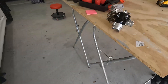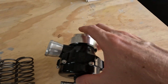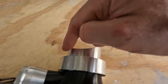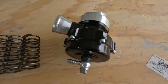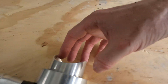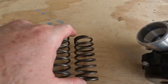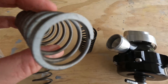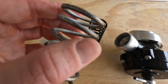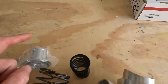I've got one last goodie to install for this video. I picked this blow-off valve up off Marketplace — it's a Tial QR recirculating one. Brand new, these are about 250 bucks. The guy couldn't use it because he didn't realize it needed to be welded on, so I picked it up for 95 bucks shipped. So that I don't have to do any welding, I got this adapter from Torque Solutions — it lets me remove the weld-on piece and use a V-band clamp instead. I've already pulled the spring out. The best spring for the Evo 10 is the black spring. The white spring is the next step up, and what's in it now is the plain spring — which is actually the one you need for a Focus ST. I'm going to swap in the black spring, get the adapter on, and get it on the car.